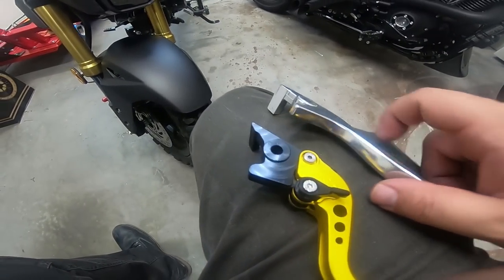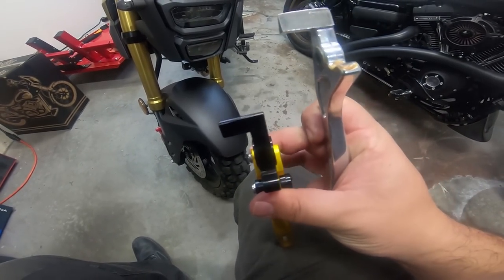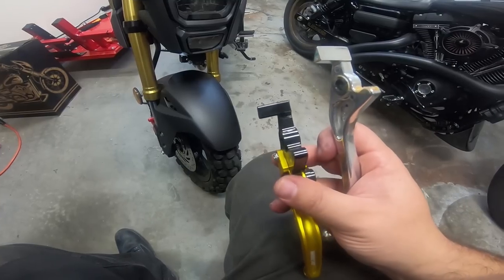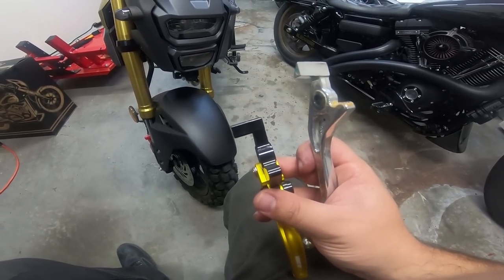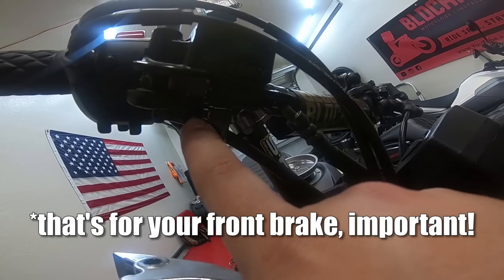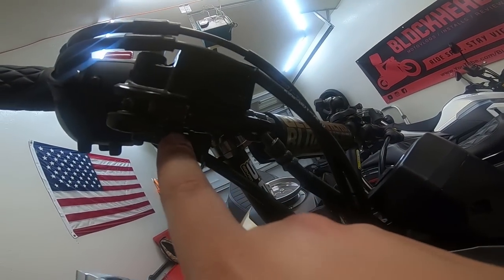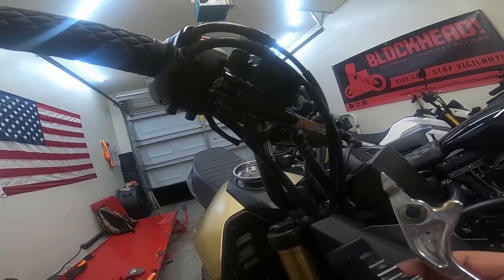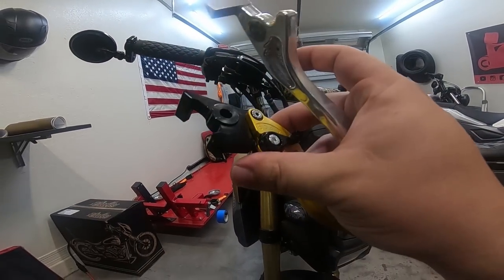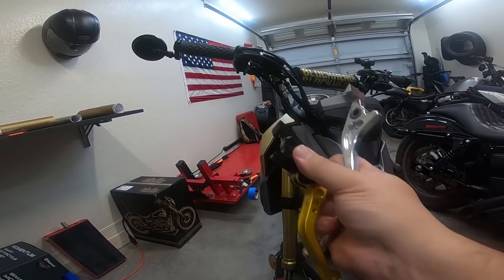So these are pretty important — you want to make sure that they do match up and line up, pretty much look the same, because the extension on the end here is actually going to press in on that button, which you see there and here. And that is going to cause your brake light to come on. So you do want to make sure that that lines up. Whenever we put it back on I will confirm, but it should be a direct replacement — pretty much just bolt this one back on.